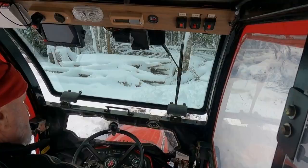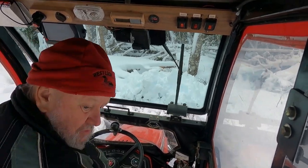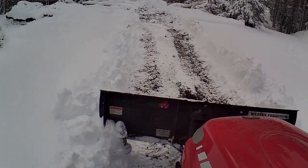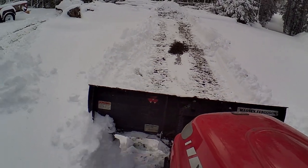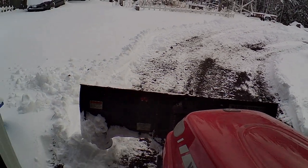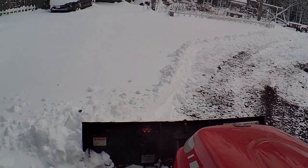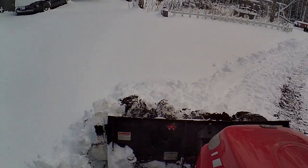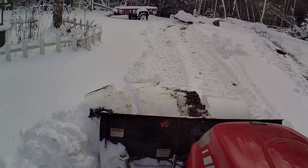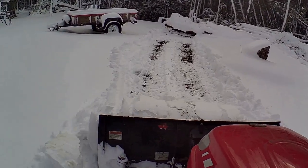The snow was wet and heavy. I've come to find out — and we'll see a little bit later in the video — that one of the main reasons I was not getting good traction is not because I was breaking through the snow so much, it's because I was only in two-wheel drive. Kind of a rookie error, that's for sure. So we're going to try this again, still playing with where there's a good setting for the blade. You kind of have to watch it the whole time you're plowing, because I'm digging up a lot of gravel. That's the worst thing about plowing with the first snow — everything is so soft, there's no frost in the ground, just digging it up.